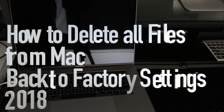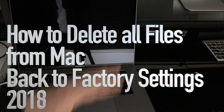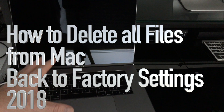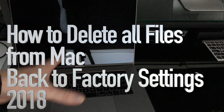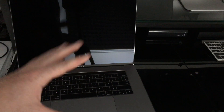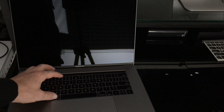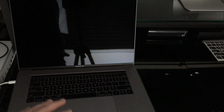On today's video I want to teach you how to reboot your whole Mac — erasing everything from it and starting right from factory settings. We're gonna be erasing all the content plus installing the OS again. To do this, before you even turn it on, we're gonna be pressing Command+R, holding those keys even before you turn it on. Then we're gonna erase the entire content, so make sure to have all your files backed up before you proceed.